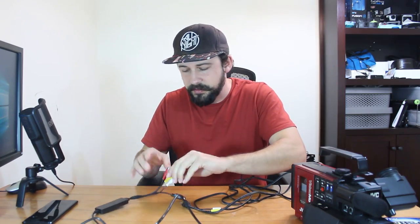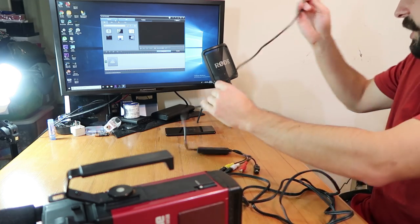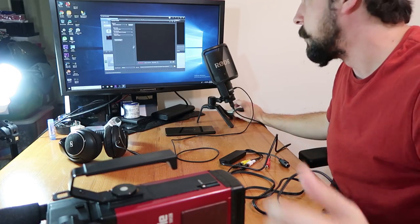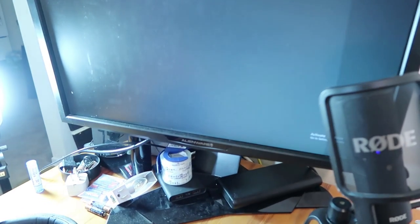The last thing I want to show you is how to get your footage from this type of camera to your computer. I bought this adapter that has a USB cable, composite cables, and S-video. That's going to allow us to connect up the correct cables to the JVC GR-C1. When you buy this adapter, it comes with drivers as well as software called ArcSoft Showbiz — you get a full license. I'll go into capture mode, hit play on the camera, and then hit capture. So it's going to capture that right now. Now if we go and watch it back — there it is. Awesome.